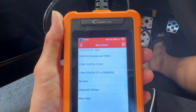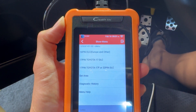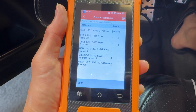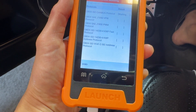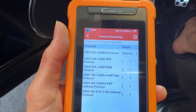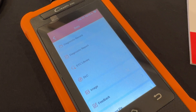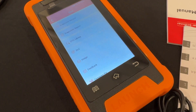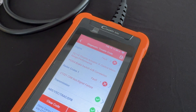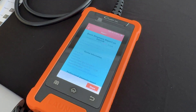As you can see on this scanner, it also has 17-pin standards, though I'm not sure where that's used. In addition to reading Toyota-specific data, this thing also has a generic OBD2 scanner. It'll scan all the different OBD2 protocols depending on the vehicle. You won't get all the custom Toyota features, but you'll get the generic codes and check engine lights for various other vehicles through the OBD2 standard.